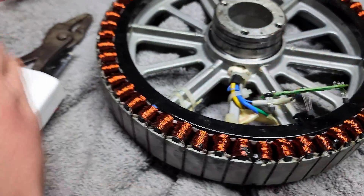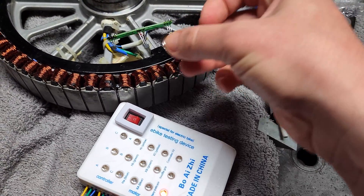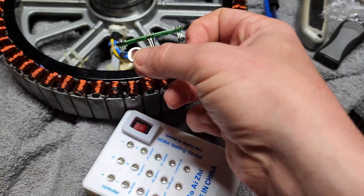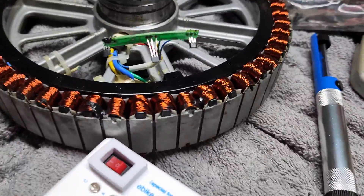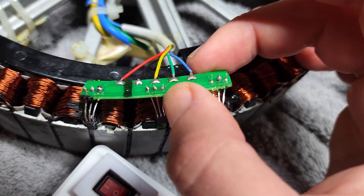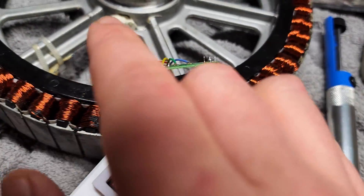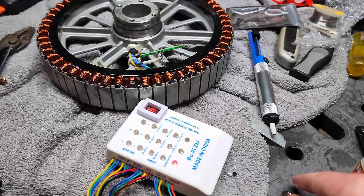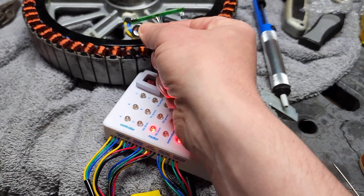Now it works perfectly. I plugged in my tester, took the magnet, and checked all three — works, works, works. It was that simple. I spent the past hour trying to figure out if there was a short in the wire or on the board, or if I didn't clean all the solder off. Finally figured it out: this one is supposed to be backwards. This little tester has proven invaluable — definitely worth the $12.